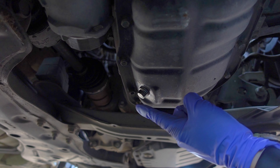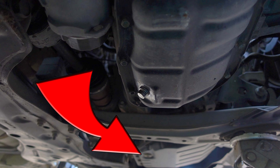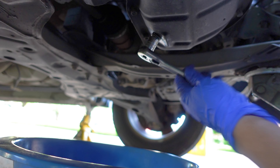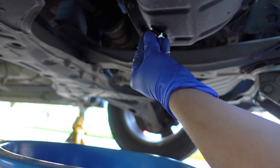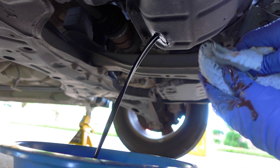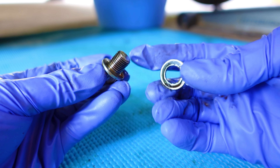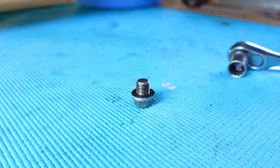I'm using the steel lip — raise the jack and line up the middle notch with the lip. Slowly lower the vehicle until it slightly rests on the jack stand; you still want the floor jack to have some contact as a backup. Throw your rag down, slide your bowl under the vehicle, and place a mat or cardboard on the ground so you can work comfortably. What you're looking for is a pan with a screw on it, usually a hex bolt. If you can locate the oil filter, the oil pan is nearby. There's also a pan with a screw on the other side — that's the transmission pan, which commonly uses a torx or square bolt. To remove the drain bolt I'm using a 14mm socket. Unscrew the bolt until you can loosen it by hand; while loosening, push it in towards the pan so it won't leak. Once it's all the way loose, pull the screw away quickly and let the oil drain. Wipe the oil pan screw clean — you may notice it has a metal washer. It's recommended to change the washer every time, but change it if you notice a leak. Place the screw aside so it won't get any dirt on it, which can go inside your engine.